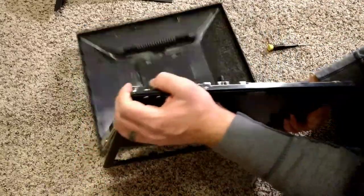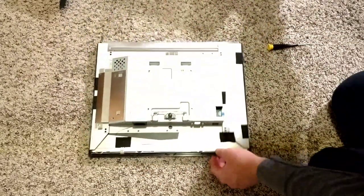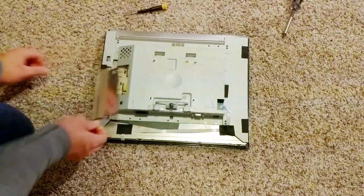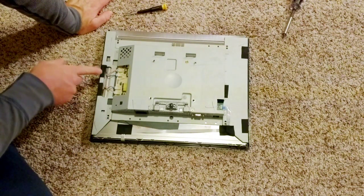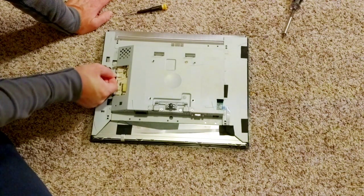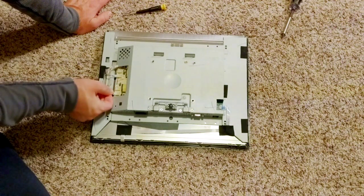Now that should remove the back part from the monitor — let's separate it. With your back cover off, you need to take your button and the spring out so you don't lose it. To get to the guts of the monitor you've got to get this cover off, then pull these plugs. Remember the configuration: you've got the pink-white, then the black-blue, then the black-blue, then the pink-white. Just wiggle them and pull until they unplug. Be careful not to nick them on any sharp edges.